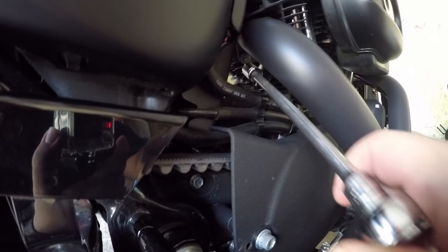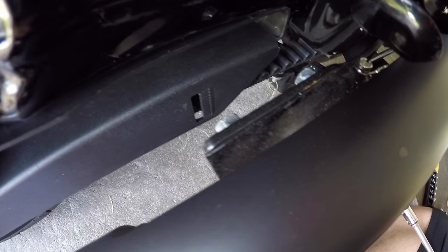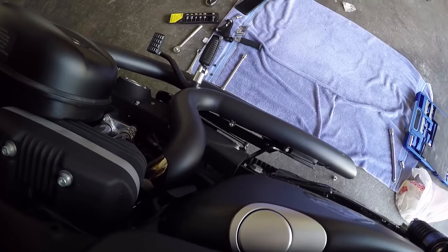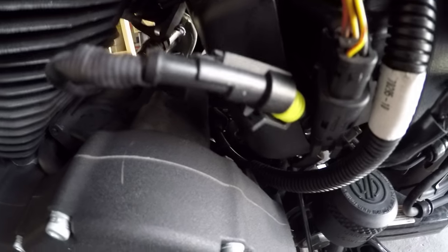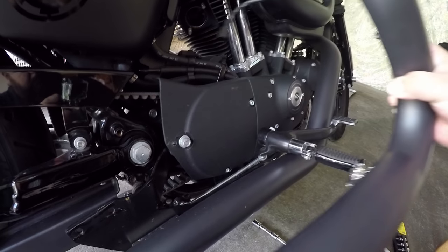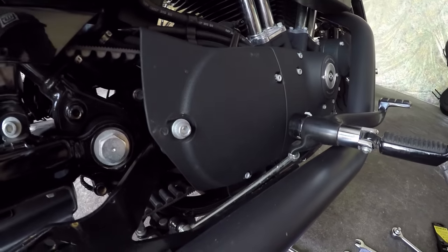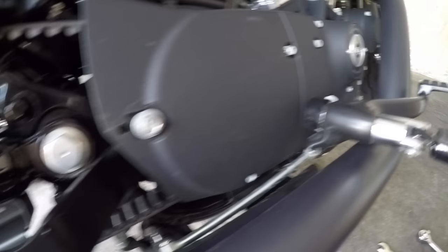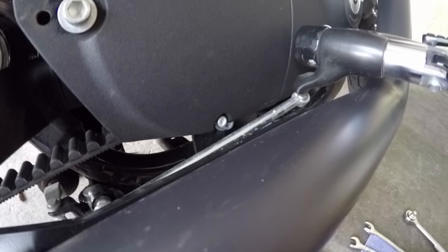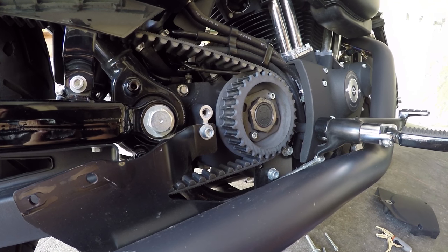You're also gonna want to loosen the bracket. I went ahead and decided to take part of the exhaust off — loosened it up at the flange, started to pull it out, and then remembered the oxygen sensor. If you're gonna take that top part of the exhaust off, be sure to unplug your oxygen sensor and make sure that's all undone. Once you've got it disconnected from the bracket as well, you should be able to just remove it. Removing that'll allow you access to the sprocket cover, which I need to remove in order to get to loosening up this bracket. You're gonna unscrew here, here, and here.